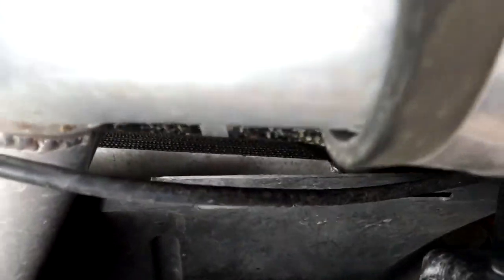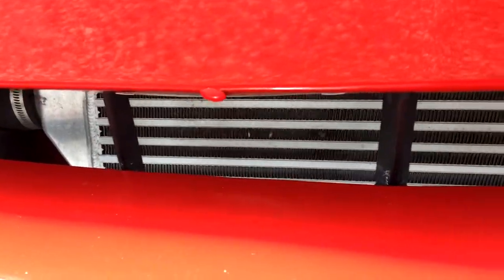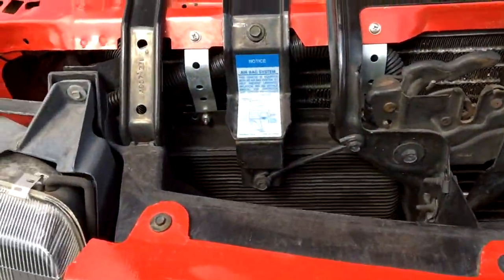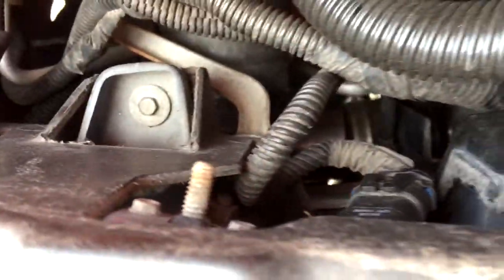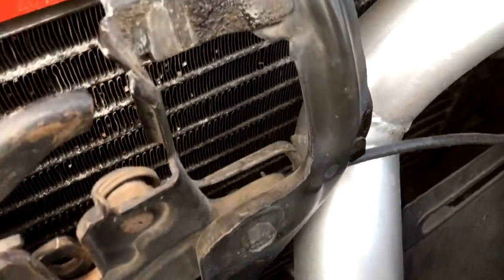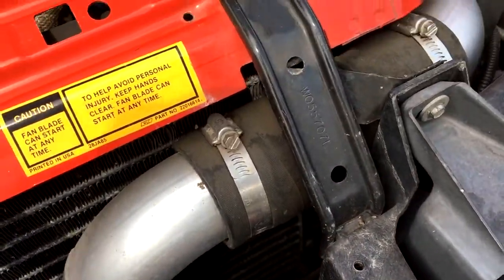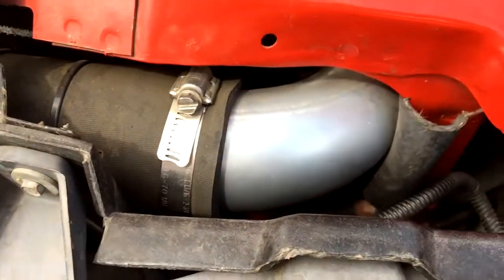the headlight, comes over to a bar and plate intercooler, 3-inch thick, I think it's 26 inches long. Anyway, then it comes back over here, has a 180 degree bend, comes back over. This is 2¼-inch tubing. Goes around, multiple bends through here in order to clear all the factory hood latch components without changing anything. This goes right behind the headlight there, through another factory hole.